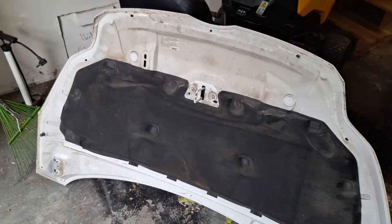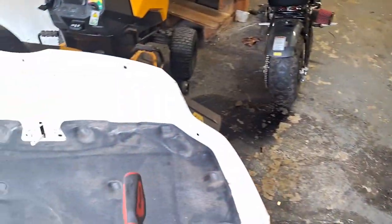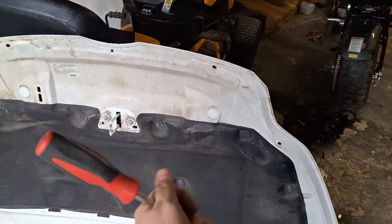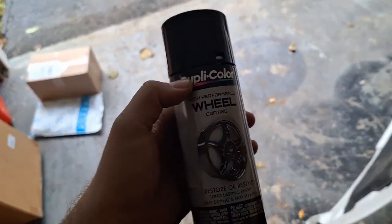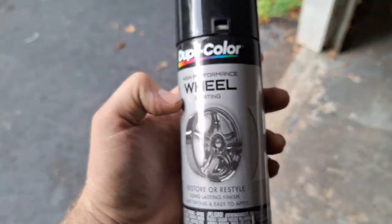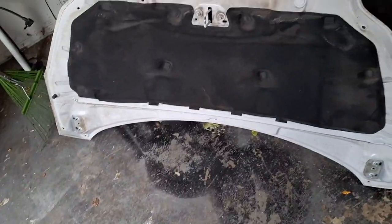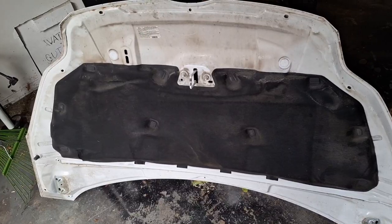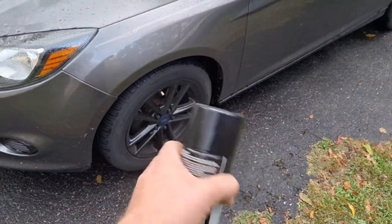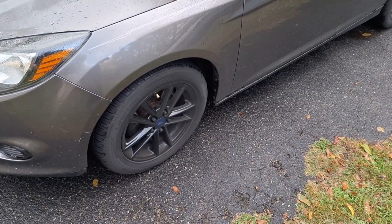Maybe I should put some paint on the back here just so it doesn't look that bad. I don't have enough of the paint I'm going to use, but maybe just some rust reformer or something to not look so stupid. I'm not a sponsor of Duplicolor or anybody, actually, but this wheel paint works magic. These wheels here, 2 years ago, they're dirty right now, but I just scuffed it with Scotch-Brite, wiped it with acetone, and sprayed it.